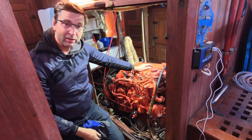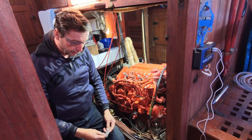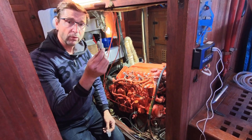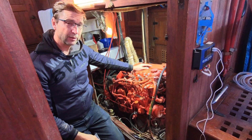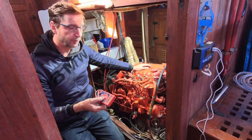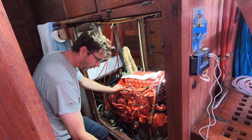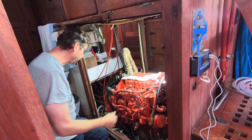I am back fighting with my old nemesis again — the engine still isn't working. A mechanic came out last week and suggested that possibly the glow plugs are the issue: it's just not getting enough heat to initially start. So I ordered some new ones — a pack of four. I need to take the old ones out and hopefully that does the trick. I'm also going to check the old ones with an ohmmeter and check the resistance, which might tell me if that was the issue or if I'm just chasing ghosts. I had a heck of a time trying to get the old glow plugs out and ended up having to remove the injectors to get access to one of them.